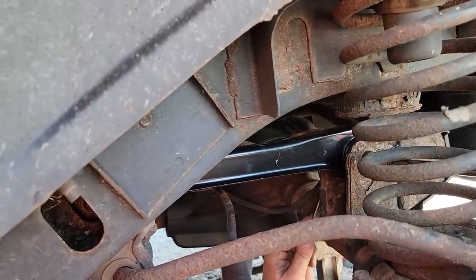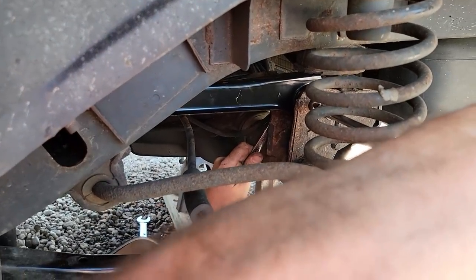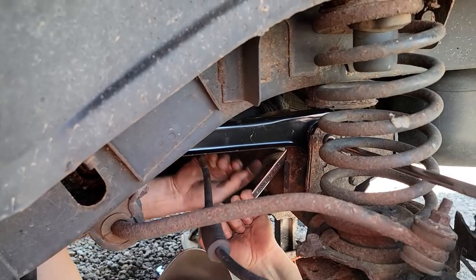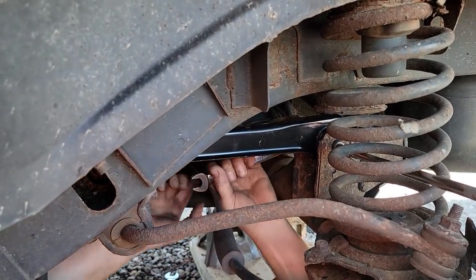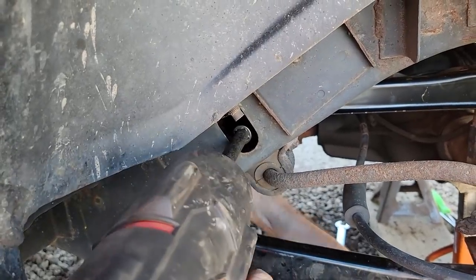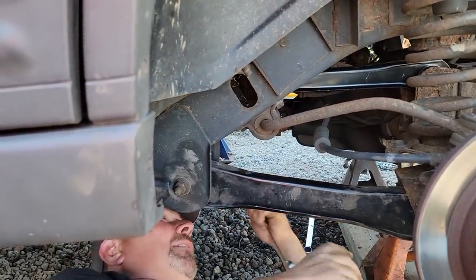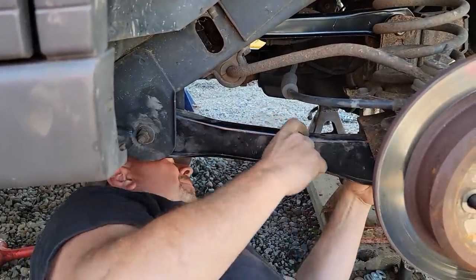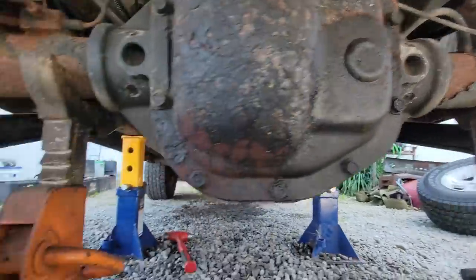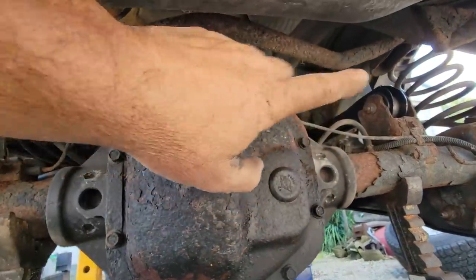The suspension has the weight - that's where we want to tighten it up. I don't want to try and tighten on that Torx bit; they're not exactly fantastic. So I'll get a socket and a long ratchet and tighten this up good. I replaced the nuts on the end with locking nuts because the ones that were on it were in pretty rough shape. The ones on this side were spinning coming off, so I just replaced them. I never-seized everything, so that's all good.